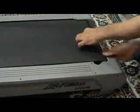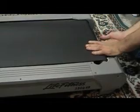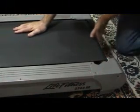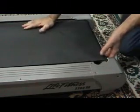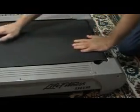I also feel the back of the roller, and then I'll spin it around, and what I'm feeling for are bumps coming up through the walking belt. It means that there may be a lot of dirt underneath the belt, some wax, things like that. It's not a problem, but it can make a thumping noise every time the wax or dirt or whatever it is goes around and hits the belt itself. And sometimes it'll make you think you have a bad roller.